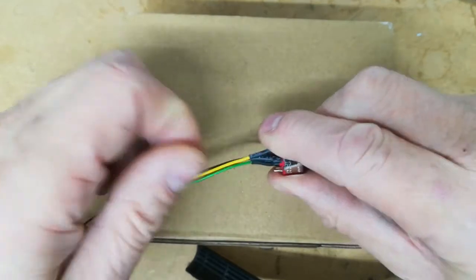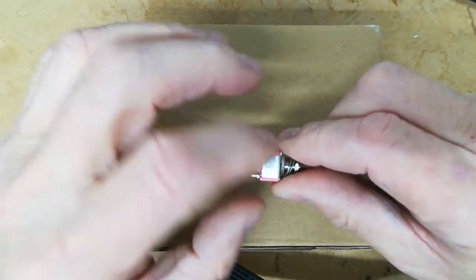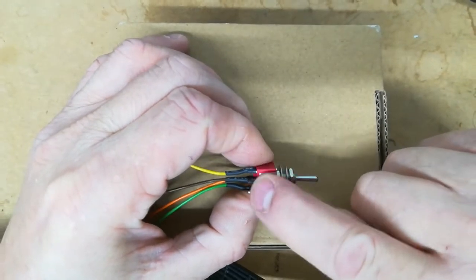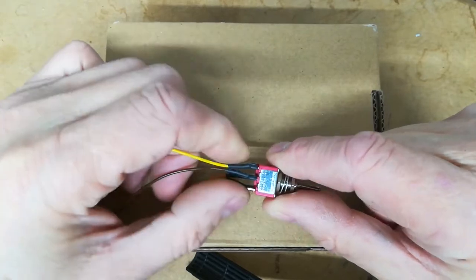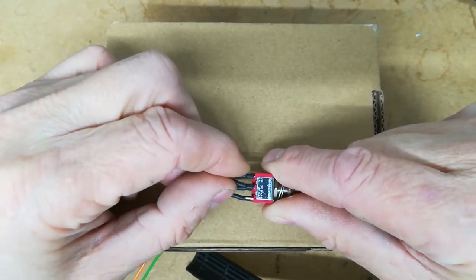In this particular switch, it's the yellow and brown wires on this side of the switch here, because when I pull this down, the non-locking position, there's a little tab inside which goes up and connects these two wires together. The brake switch in the CRZ is just a simple 12-volt line: when you put your foot on the brake, it connects the 12 volts to an input onto the ECM.